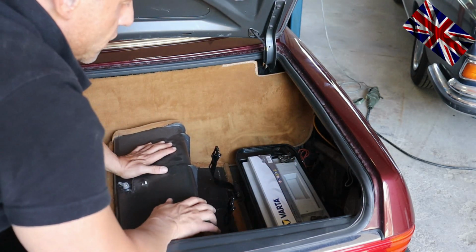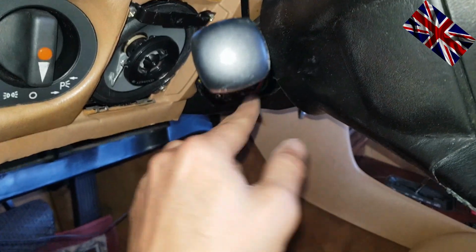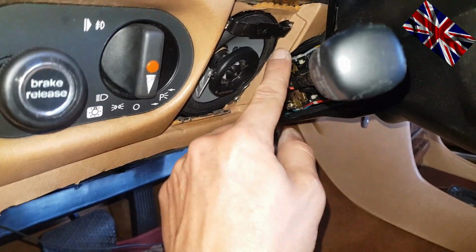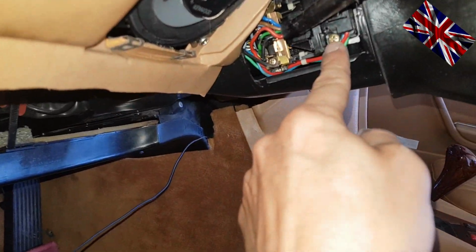We disconnect the minus of the battery and go back underneath the steering wheel. That rubber cover is easy to remove. We now got access to the screws underneath it. I removed the cover of the loudspeaker as well to protect it from scratches while fiddling with the stalk.